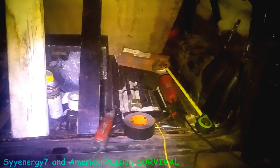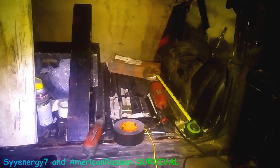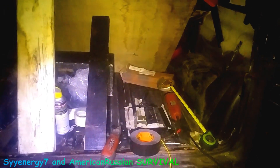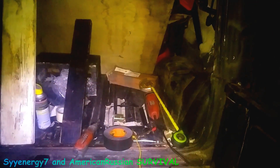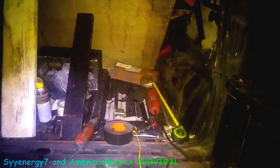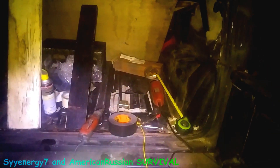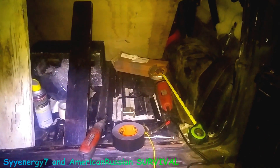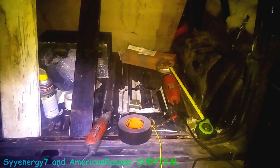This is the old sending unit - it was replaced. There was nothing really wrong with it until this one problem: the muffler was leaking and I didn't think it was a big deal. But the exhaust gases were going up into an area under the body that caused the wires to melt. I had to rewire all the wires going back to here, plus the fuel sending unit got damaged. It doesn't read right in some spots - it reads fine when full and around a quarter to a third of a tank, but there's a dead spot where it could be two-thirds full and read empty, until the Samurai bounced around and it jumped back up.